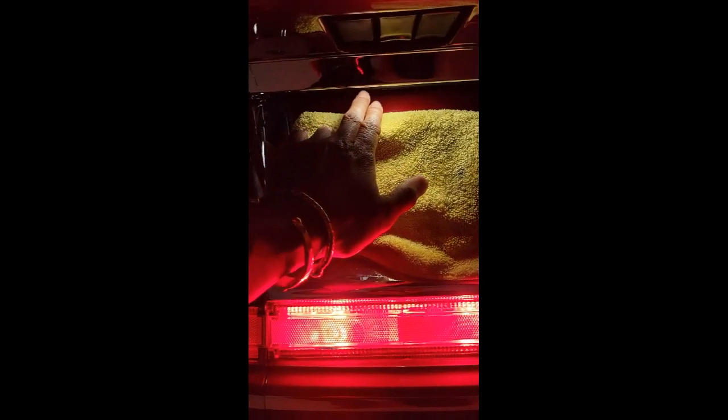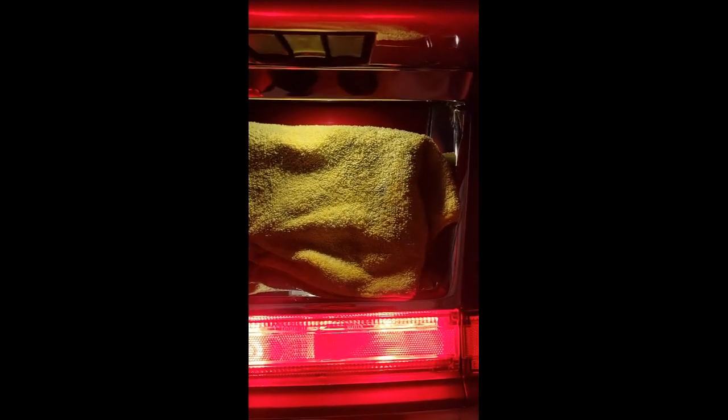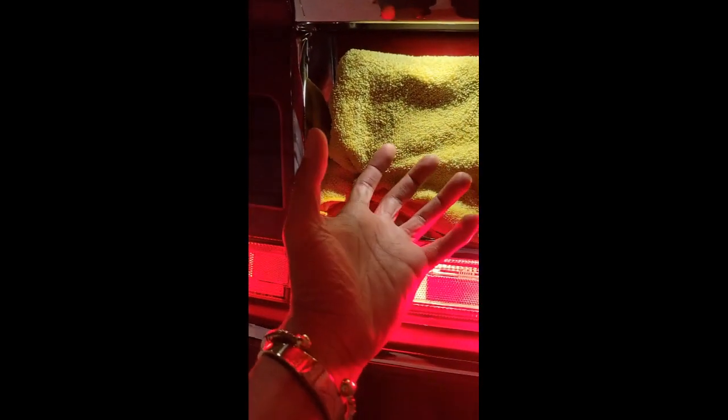The actual turn signal flashers for the bike are underneath here. They're just right up underneath here, underneath this panel. You do not need to disconnect the trunk to get to those turn signal flashers. You just need to disconnect or disengage one of the saddlebags on either the left or the right side here, and just move it over 1 or 2 inches, and then you can disengage this piece right here, this whole center piece right here.